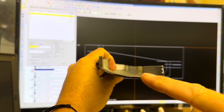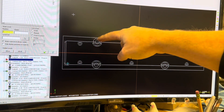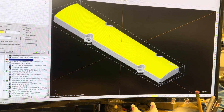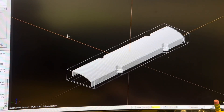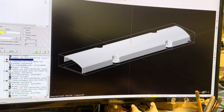I just started by drawing this shape — it's an extruded shape, like a piece of extruded metal that's forced through a die to create a profile shape. Then after I extrude the shape I add all of the mounting features to it. As I rotate the solid model over you can see that this is pretty much just like the OEM one, just missing the Honda logo and the Honda lettering. I wanted to start with a simple shape because I wasn't quite sure if adding additional features or design would take away from the simplicity I'm going for on the top of my valve cover. Starting with a clean simple design I can always go back and add a design feature to the top later if I decide I want to.